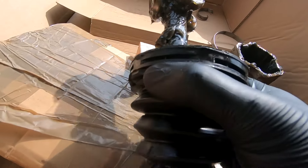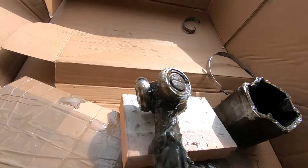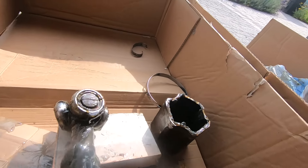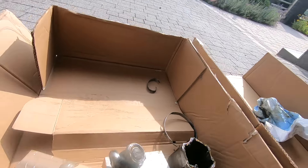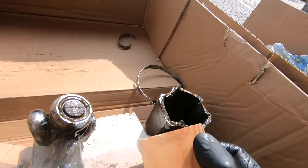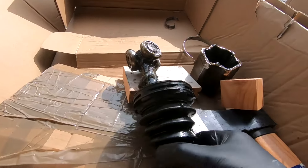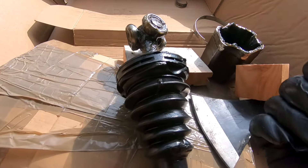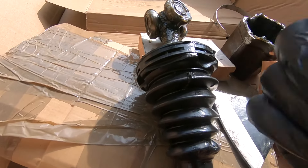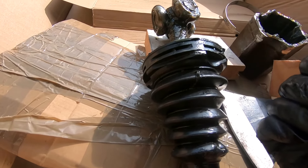Now there's a shaft exposed and there's a bearing. So now we're going to get the bearings off — we're going to knock them off. We'll put that on a piece of plank of wood and use a block to just take them off. That should then enable us to take this rubber boot off. I could cut it off, but we've got to get the new one on it as well, and we won't be able to do that without getting these bearings off. So let's clean up the rest of this grease and then we'll take the bearings off.